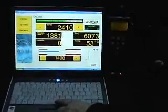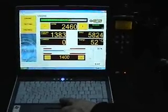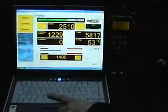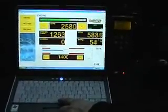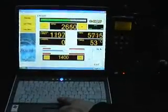Got a petrol. We're looking for 6 milliseconds duration, 5.9, 6 milliseconds. Fuel trim there is at -7. Go to gas. 5.7, 5.8. Fuel trim there, approximately -3, the same as petrol. This has proved the car's now set out on the road.